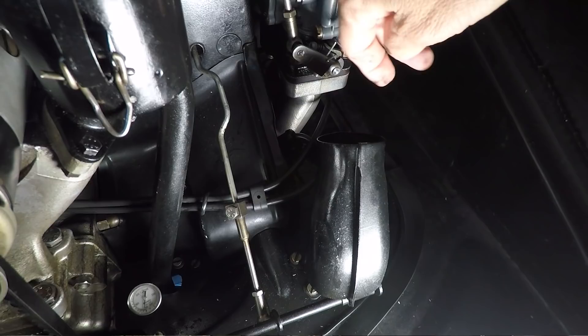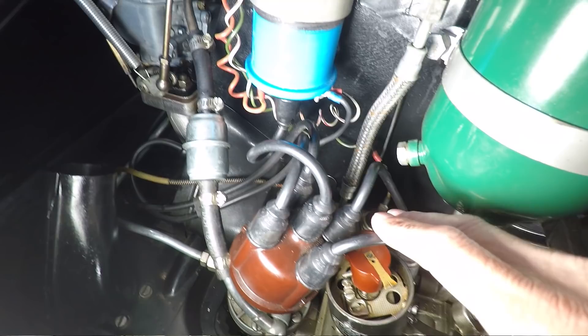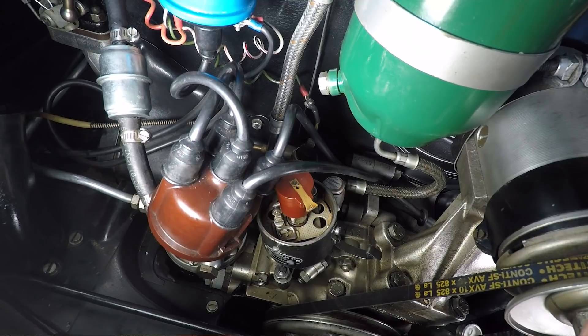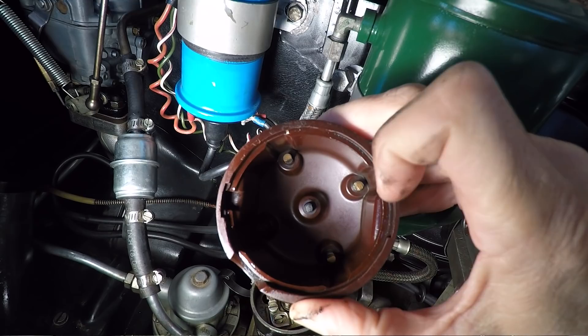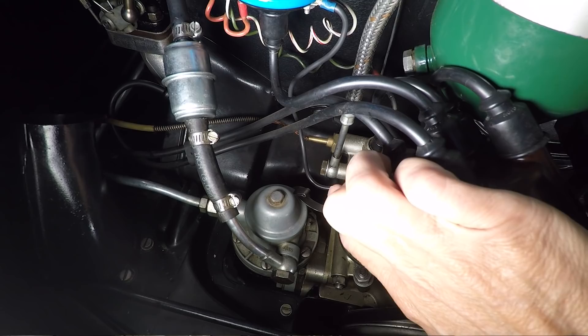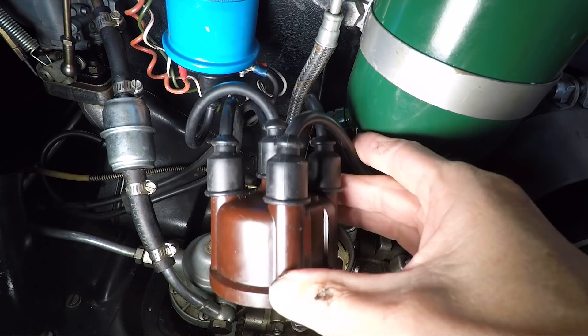I want to trace this wire coming out to here. As this wire goes back we know it's going to cylinder number one, and the one next to it is number two. So coming back: this is number one, this is number two — one, two, three, four. The cap only goes on one way — it has a small notch and a big notch that lines up with the post on the clip, so cylinder number one is on the opposite side.